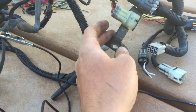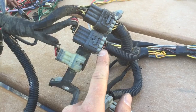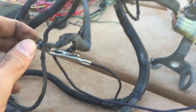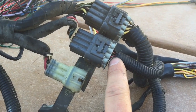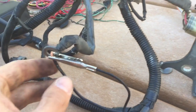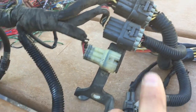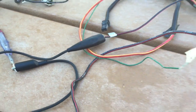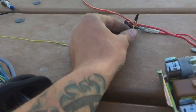This test light connects to a ground. I'm lucky enough that I pulled this harness for a client, so this is start to finish — I was able to plug in the engine connectors into the actual engine harness which contains the major ground. If you want to replicate this test scenario, just find the ground pin on that connector, hook your negative up to it, and from the ground we go back to the battery to complete the cycle. So let's test the fuel pump — connecting this now, and you'll start hearing clicks from the fuel pump relay.